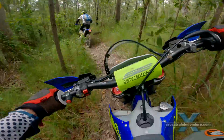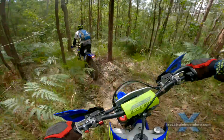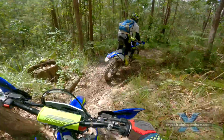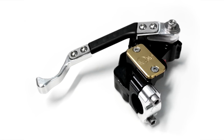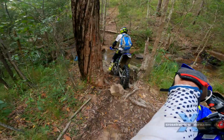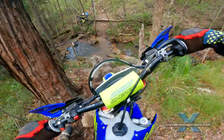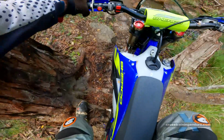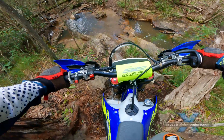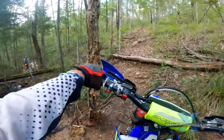Unfortunately, the clutch lever broke in a simple crash at a standstill. The Brembo clutch mount is very expensive, so I bought a Clake One Light clutch instead. It only cost about $70 more than the Brembo unit. The Sherco clutch is quite heavy compared to most other brands, so this has fixed that problem dramatically. The clutch feels as light as a trials bike now.